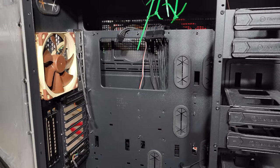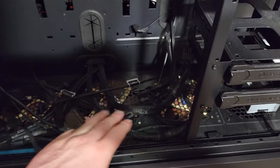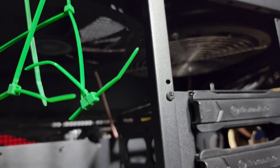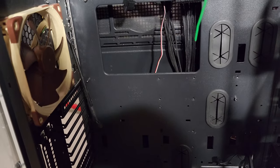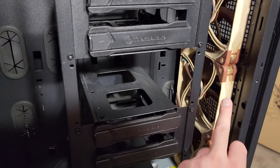I suppose it's time to put the motherboard in. But first, I need to address the cooling. In this case I have three Noctua fans on the bottom, three Noctua 140mm fans at the back, and three 200mm fans to help with convection. Most of the air comes in from the bottom to the top. Sorry about moving the phone so much — I should be using a tripod.